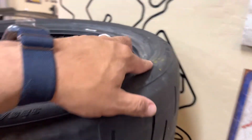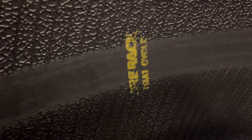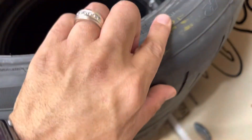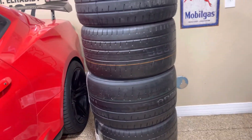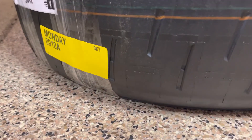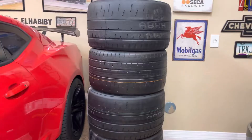Tire Rack will stamp the tire indicating it's been heat cycled - you'll see that usually on the inside of the carcass of the tire and also on the tire walls. So if you're on grid and you notice it, that's what that is. When you order a heat cycle, they come with a date, and that date needs to be on there because you want a minimum of 24 hours for them to cool down.